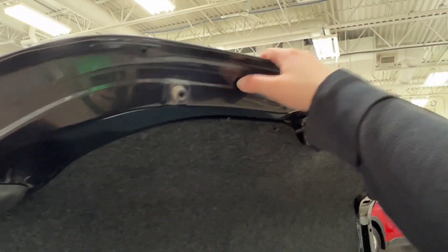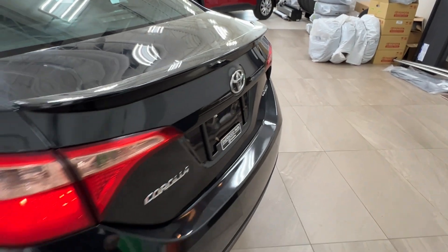If you're looking for your spare tire kit, simply look down at the ground. You'll be able to find some little notches. Lift up your false floor, and everything you need will be stored right underneath. To close it up, just reach up to your trunk, pull it down back into starting position.